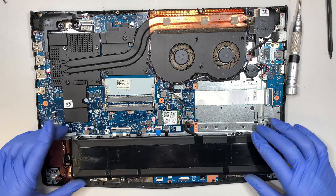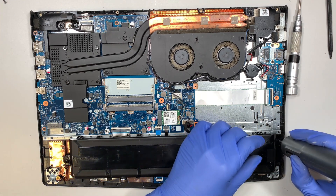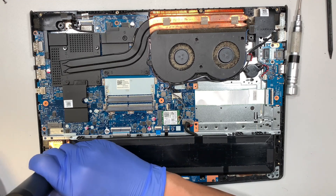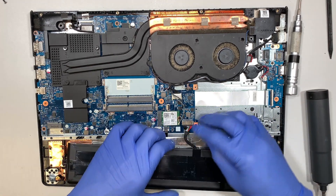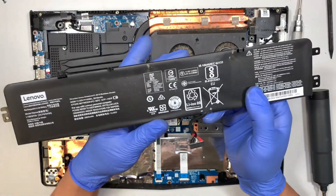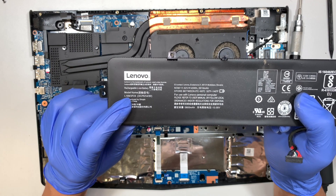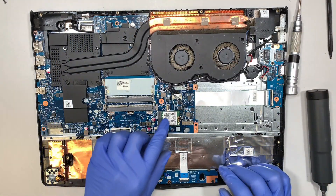This is your battery, and to remove the battery you need to remove the screw. Slide the connector down and that's how you remove it. If you have a swollen battery — if it's lumped or not holding a charge — it's time to replace it. The battery model number is L16M3P24.